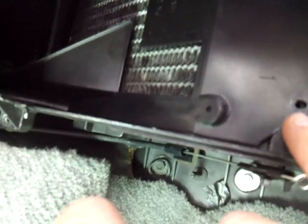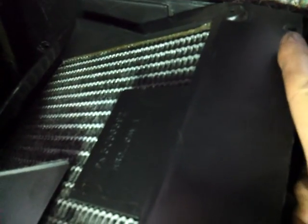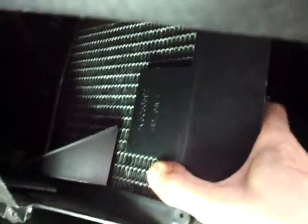The last thing over here is four bolts holding this thing in place. There's a bracket that holds the whole heater core in place — one bolt goes here, one bolt goes on top. For the small ones you'll need an extension like this, and for the others you can use a small extension to get the one up there. There's a bolt there and a bolt up top, so four bolts total hold this in place.